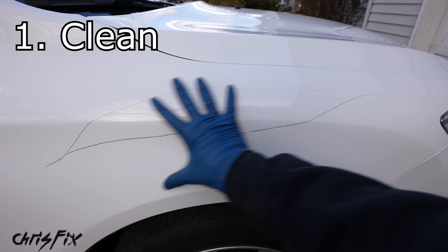After letting the paint dry for about 10 minutes, carefully remove the tape — don't just rip it off. Pull the tape back on itself slowly as you remove it. Pull the edge at a 45 degree angle away from the touch-up paint to give it a nice sharp line without damaging the paint. For tape you can't peel off, use a straight edge to lift the corner up so you don't damage the touch-up paint with your finger, then it should peel off nice and easy.